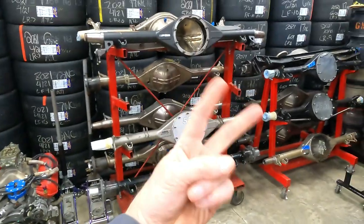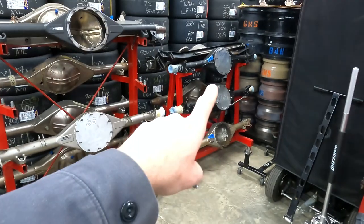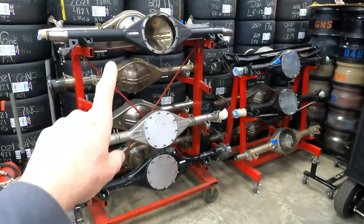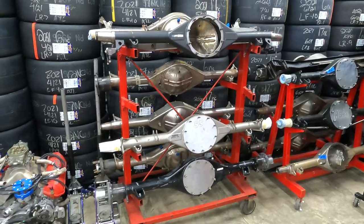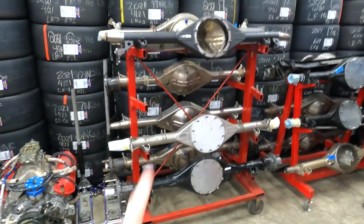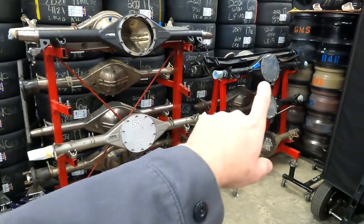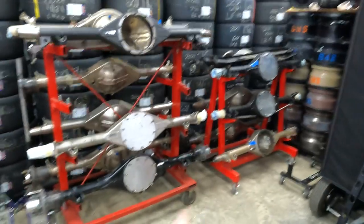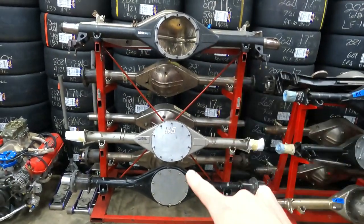Okay, guys, I've got two different racks here. On the right, these are 58 and 60 inch housings for Gen 4 Cup cars and Busch cars and truck series housings. On the left, these are 61 inch Gen 5, Gen 6, and Xfinity car COT chassis housings. There's a big difference between the two in width, and the older car has a 1 inch narrower truck arm pad width. That's something to keep in mind when you buy housings.